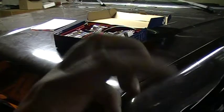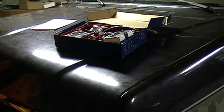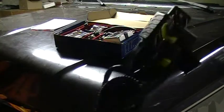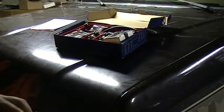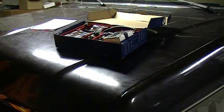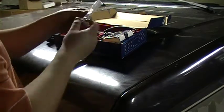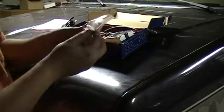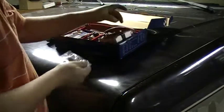And it'll blow this fuse here instead of melting your wiring. And it just takes the strain off your headlight wiring harness. So definitely get these. Don't get any HID kits that don't come with these or don't have these as an option, because they're garbage. And you just don't want to take the time to have to replace your wiring because you didn't get one of these. So that comes with it. Also comes with bolts for mounting your grounds.